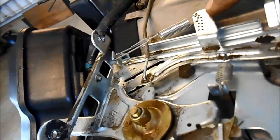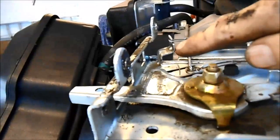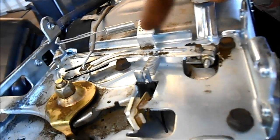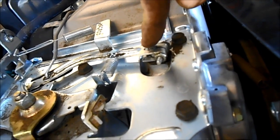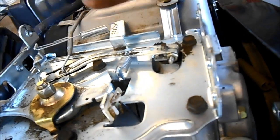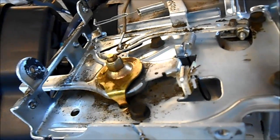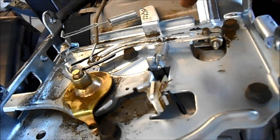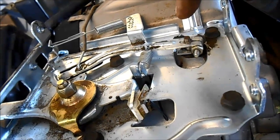I ended up putting the spring in number five. You can see I bent that back just a little bit, and we are actually all the way to the left on the bar to the stud, which is what the manual actually says — it says you go all the way wide open and then tighten it. It does surge a little bit, so I'm just going to see if the carburetor is dirty. Surging is not a governor issue, although many people turn up the governor to stop surging and then your engine can over-rev.